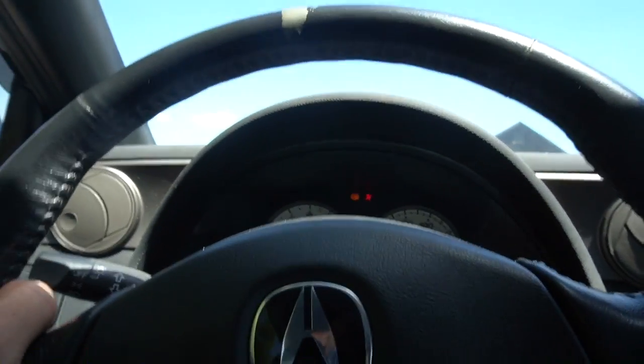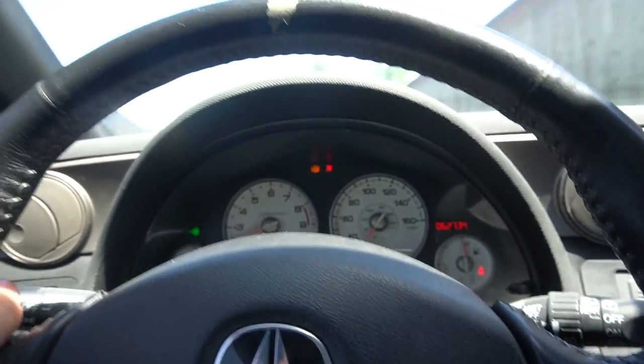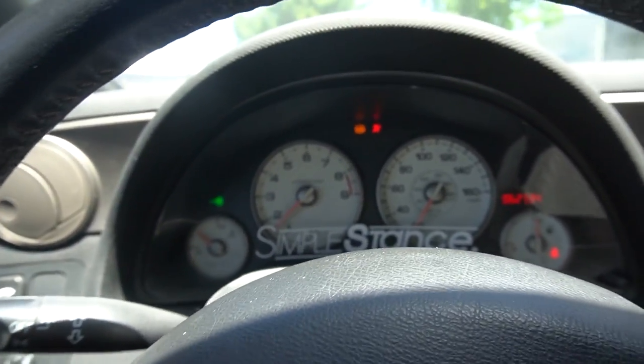We're good guys — this thing is a lot better. I'm pushing the clutch in all the way and it's not getting stuck at all, drops right back down. I'm at a touchless car wash and the car is running a lot better. I feel like it did fix it — I didn't feel it getting stuck at all. I think it's closing all the way now. I'm going to put this to bed: adjusting that spring is how you fix it.